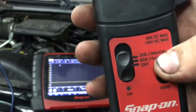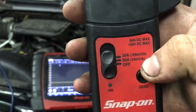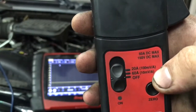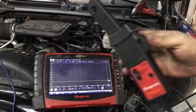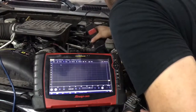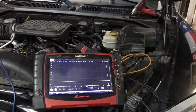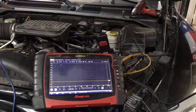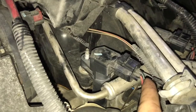We're going to put it at the 60 amp scale — for every 10 millivolts it's going to equal 1 amp. So 100 millivolts equals 10 amps, and 1000 millivolts — basically 1 volt — is going to equal 100 amps. I'm going to set this up to about a 5 to 10 volt scale. I'm going to hook it up on the battery positive, going to the actual starter. Then I'm going to hook up my second channel to the primary side — the control wire of ignition coil number one, where one wire is battery positive and the other is the control wire.